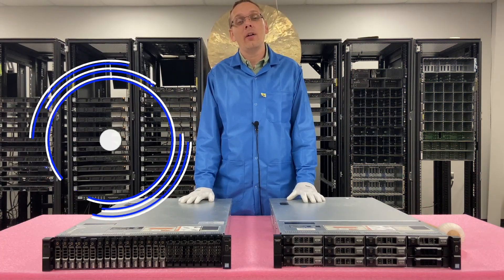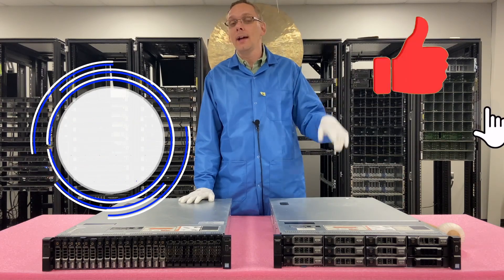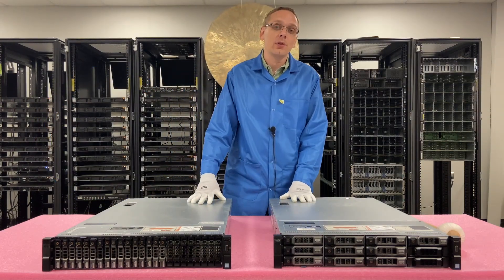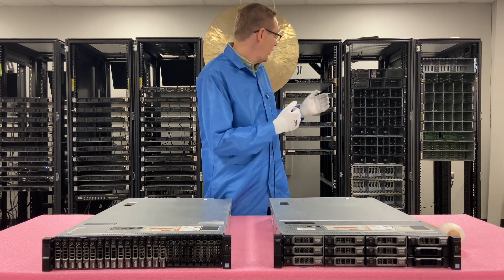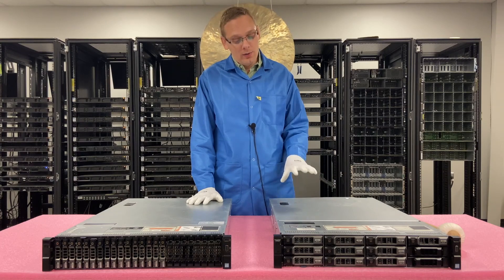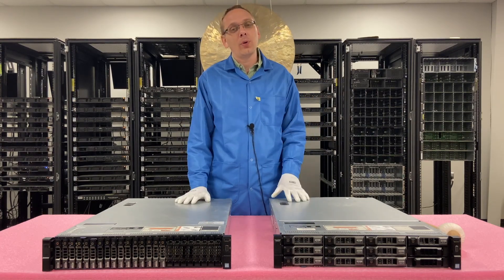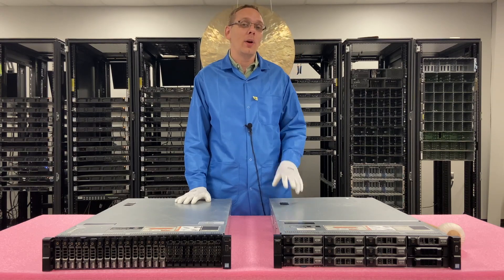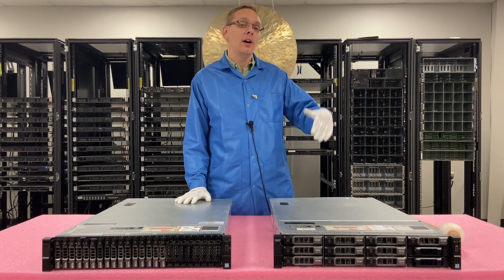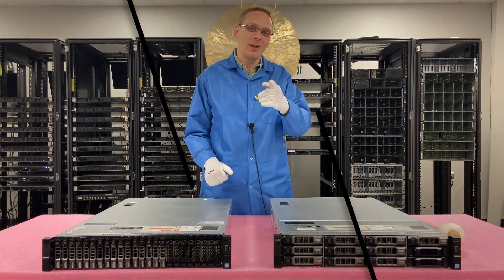Thanks for stopping by today to learn a little bit more about the Dell PowerEdge R730XD. If you're finding things in this video useful, click that like and smash that subscribe. So this video is going to be focused on how to take my server and put it into a rack — it's really just that simple. All you're going to need is a set of rails, the rack, and your server. I do recommend having two people to do this; it makes the process a lot easier. We'll have an extra tech in the back and I'll show you how to do it from the front.